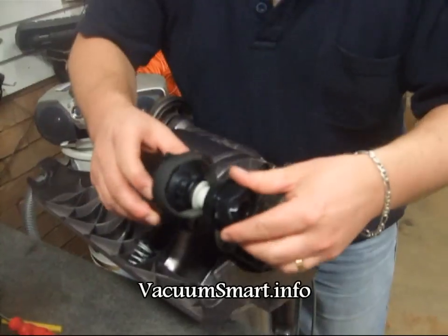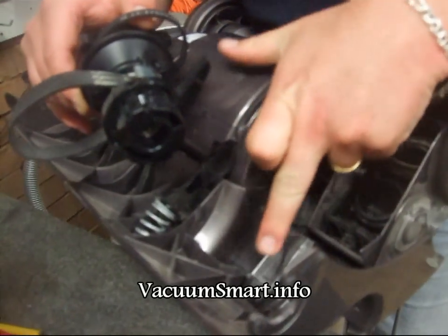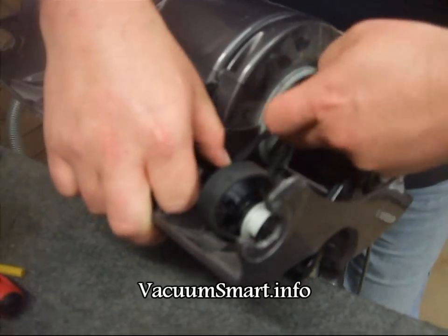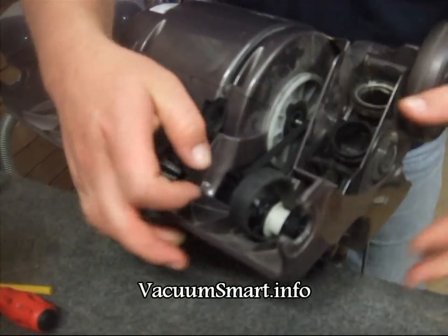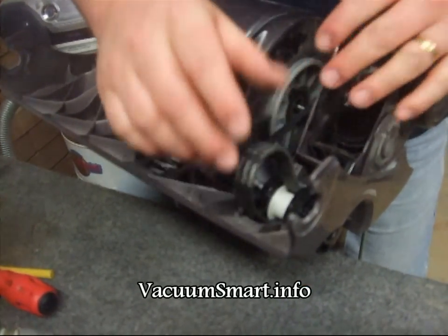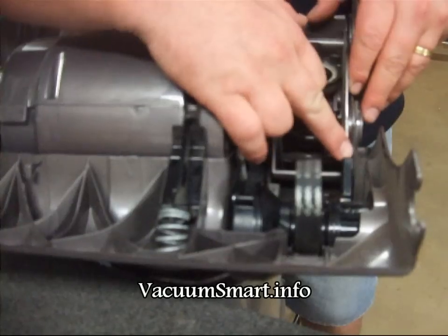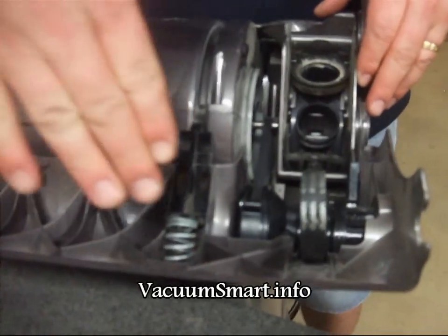It's fairly easy to put this back into place. You just line up your two holes here and here with your locators there and there, and it will click into place. Pull your belt up and just test that it runs freely. If that runs freely and the belt is in position, the clutch is installed properly. Note that this arm here lines up with the body — that's what actually engages the belt when you lower the handle down.